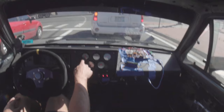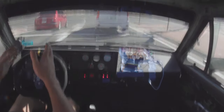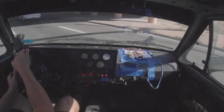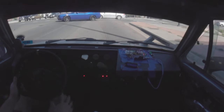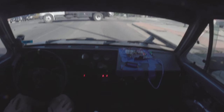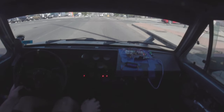For the overheating issue, my radiator is literally blocked by the intercooler and then by the front of the car, and the air doesn't even have to flow through it if it doesn't want to. The air just definitely doesn't flow through it, and that's why it gets so hot. It's definitely a big enough radiator. I think I might try to address that problem before I swap the ALH in — or I might not. Really all that's required is to block off everything up front except where the radiator is, since there's no room to add ducting.